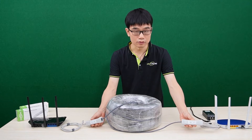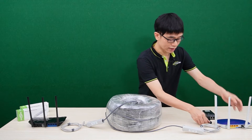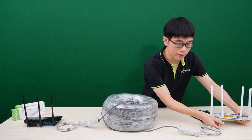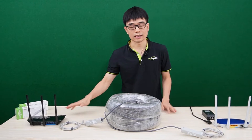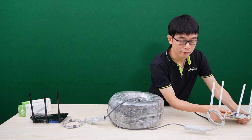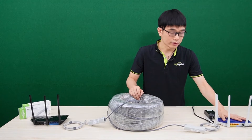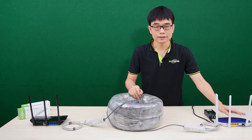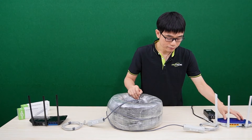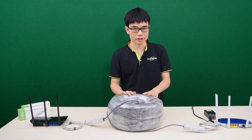We still keep the same setup with the two PoE extenders, with the first one flipped. We're supposed to connect the cable to one of the internet ports, hoping it will provide data to the second router. But it will not work if we just connect this cable to one of the internet ports. This is just a regular router — it doesn't provide any power. If it doesn't provide power, the two PoE extenders will not get power, so the whole system will not work.